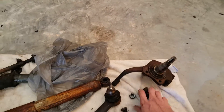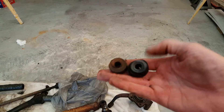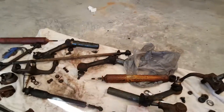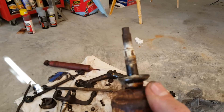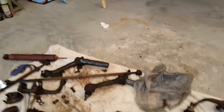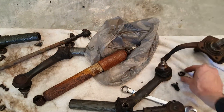On the top of the shocks, I need to check whether these come with the shocks or not. There are two rubber bushings and a metal plate. On this side I could only get one of the metal plates off; on the other side I got both. The other one's probably still sitting on the shock — yep, right here. This is one I haven't taken apart yet. There's the bushing, it goes here, this is your old plate, you feed it through, then another bushing and another little plate, then your nut on top. That nut is just one of these regular ones — I think they were 17 millimeters.